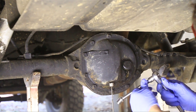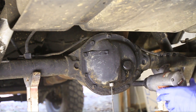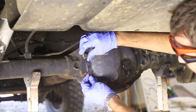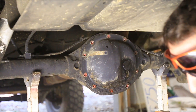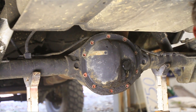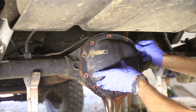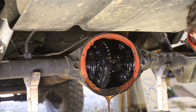In this case, we're not going to check it or top it off — we're just going to take the cover off and drain it all. You can use a socket wrench to pull these bolts off, or a faster way is to use the air gun. Now once you get to this little tag, make sure you keep that — it has important information like your gear ratio and your axle type. Set that aside and put it back when you're done. Take your bucket, put it underneath, then take your hammer and give it a nice firm tap. Let the oil come out, and you can pull your cover right off. It's that easy.